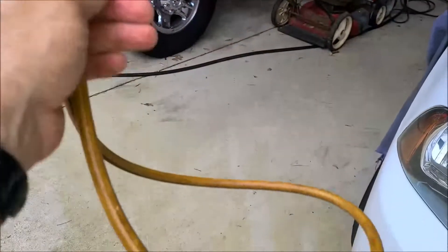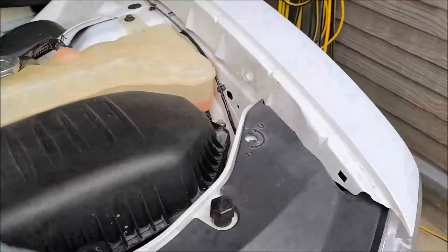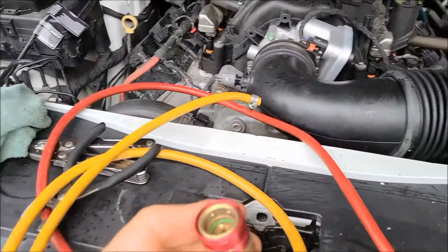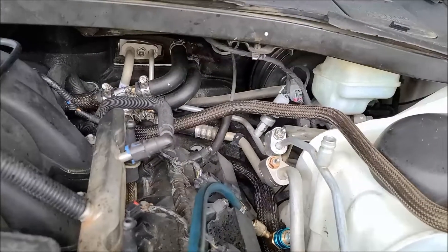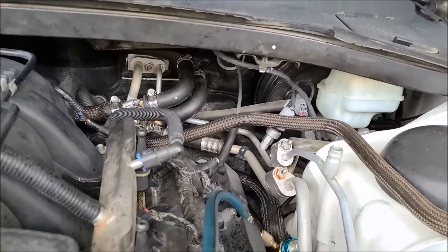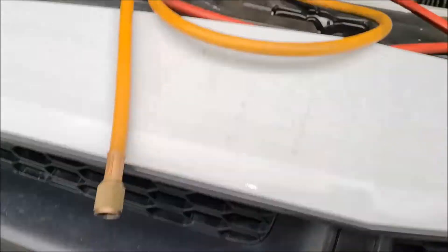What we're going to do is fill up this yellow hose all the way with the stop leak, and we're going to change out the ends from the red hose. The red hose is going to go in directly — I want to charge it into the small line. The port is right there on the Dodge Charger, and that'll shoot it in the direction of the evaporator. Then it will go through the expansion valve, through the evaporator, back to the suction line, the large line, back to the compressor, back to the AC condenser and filter dryer, and make the circle.